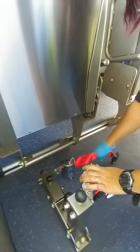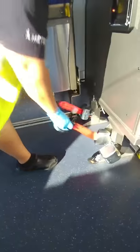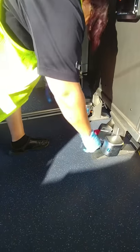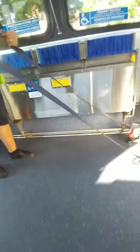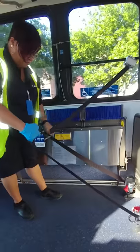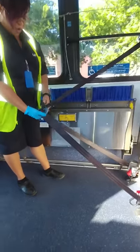Make sure all ADA straps lock and retract back. Checking the passenger strap — pulling them out, making sure they're not ripped, torn, or frayed in any way, that they come out without being twisted, and that they actually lock into position. My shoulder strap — I want to make sure that it too locks in here properly and is not twisted, ripped, or torn in any way.